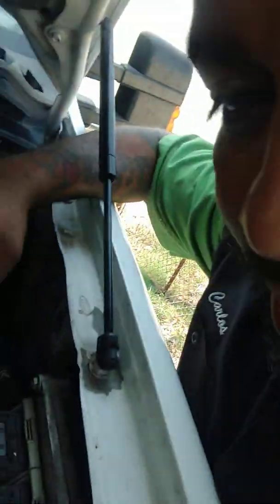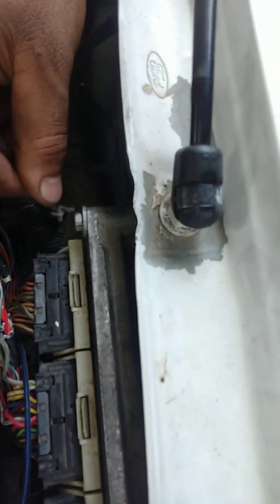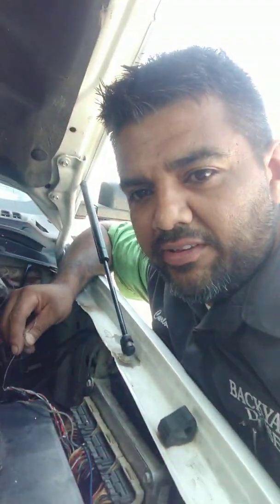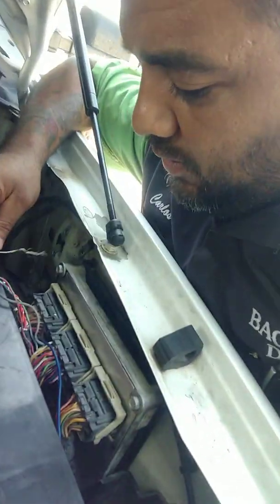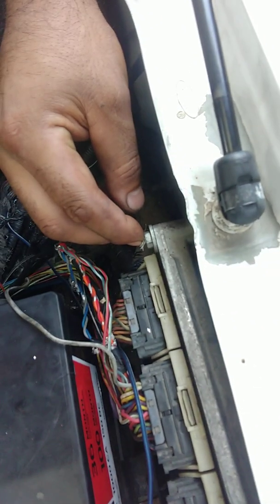That's your problem. Hopefully this helps — it's kind of weird, I've never seen this before. I've found shorts on several other things, but not on the FICM itself. Maybe somebody else has seen it. See, you didn't hear the injectors because I pulled that ground off. Now I know where the problem is — here's the ground that goes out to the FICM. You hear them? I just opened them up and grounded it out.